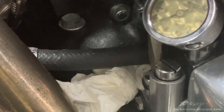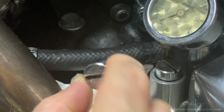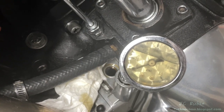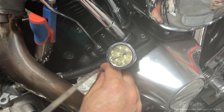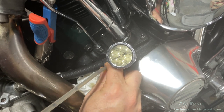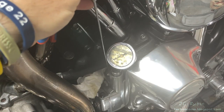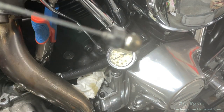I have a large fitted screwdriver that I use to break the tension on that screw, which is the cap, and then unscrew the cap right off. There's a spring under it and I pull the cap and spring out together. It's completely filled to the rim with oil. I take a long length of silicon hose, suck out the oil, hold the end, then deposit it into a small container — repeat as needed until there's no oil all the way down to the check ball. Then using a small telescopic magnet I grab the check ball and pull it up out of the oil pump.